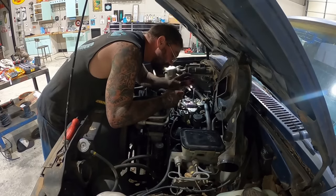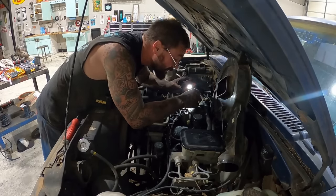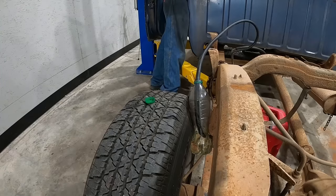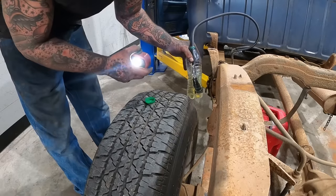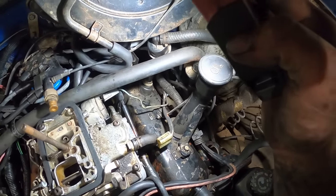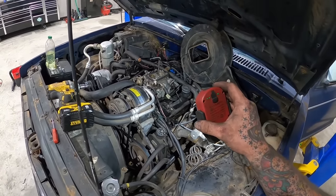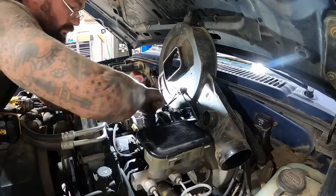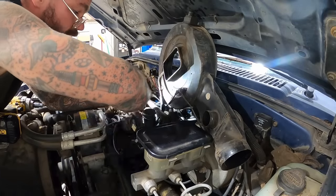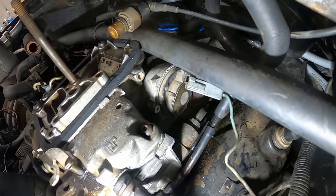And I'm literally picking the bowl, or the float, up and down right there. I can get to it. That right there tells us our pump is pumping. I wonder if this has something to do with our filter setup. Somehow that got, I don't know. I guess we'll crack our line there. I'll let y'all keep an eye on that. I'm gonna crank.